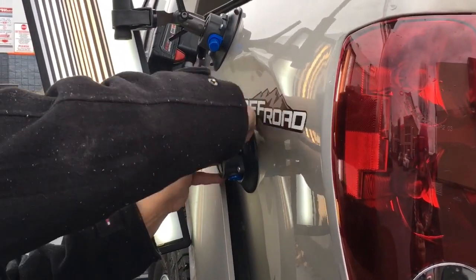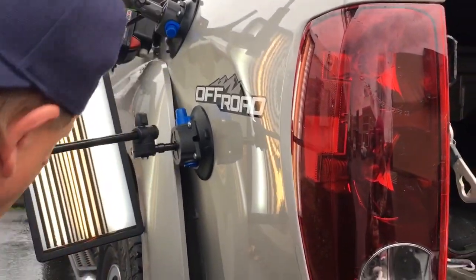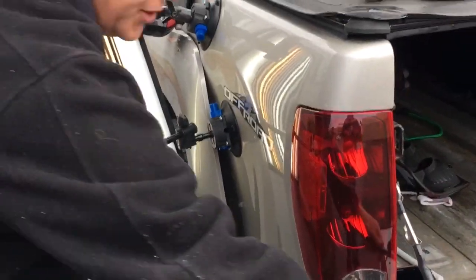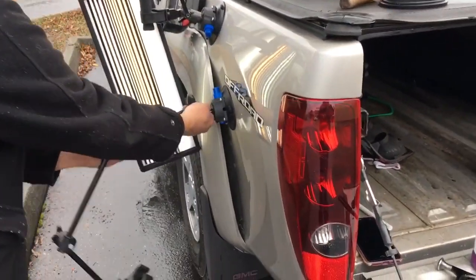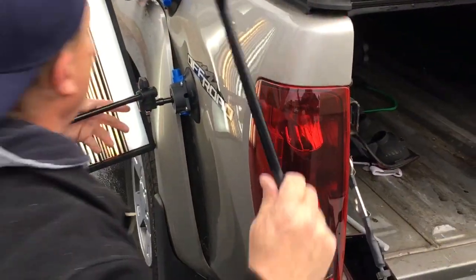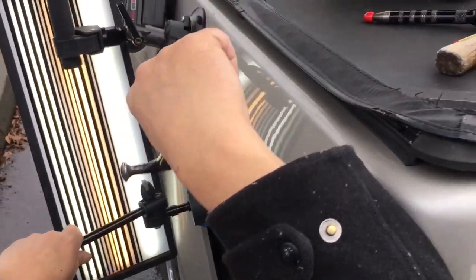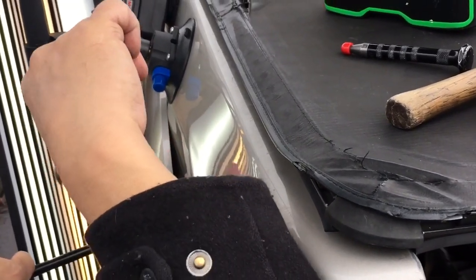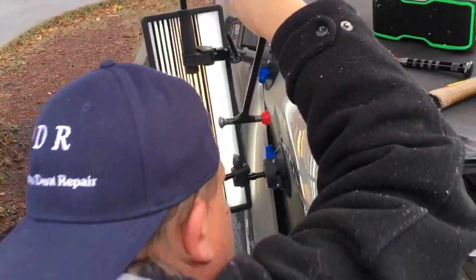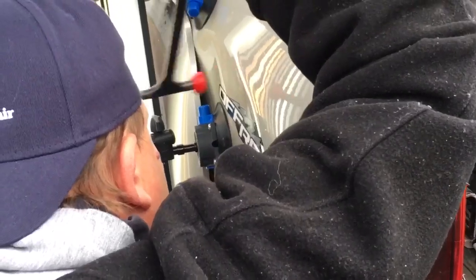I thought I'd just grab the strong arm and put it on there, and see what I can get out of this, because I know I'm gonna have to pull and hammer at the same time. So I thought I'd bring you guys in for this really large dent — the non-conventional type of paintless dent repair. Now that I'm looking right into this brow, I can see it is really tense right here and all the way up around here. As I'm kind of pulling on it, I'm releasing that tension right there.